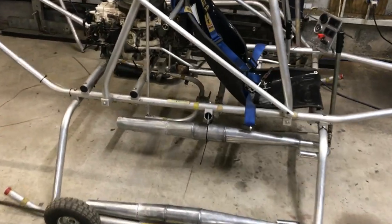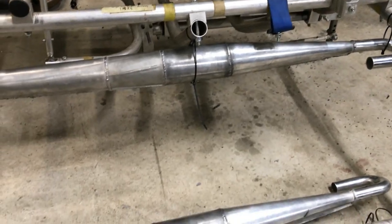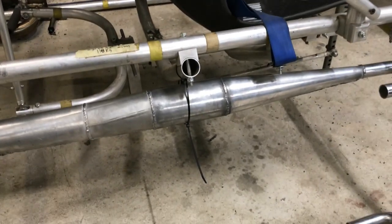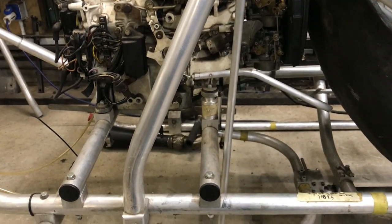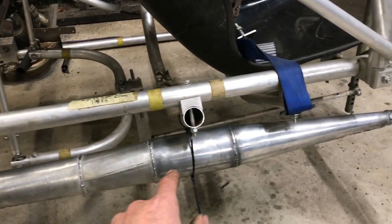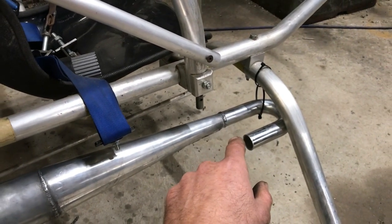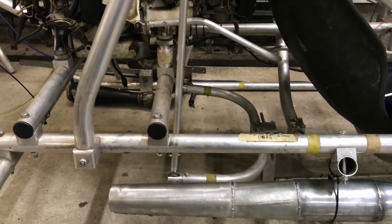So this is what I've built. As you can see I've built two, and that is because there are two cylinders and I want the sonic pressure waves to go back into the right cylinder rather than get split and not made the most of. When the engine blows out the exhaust you get a sonic pressure wave which comes up out through the diffuser cone into the baffle cone, and at this point that is considered your tuned length. The distance from that point to the port in the engine is the tuned length, and that is determined by a few things.